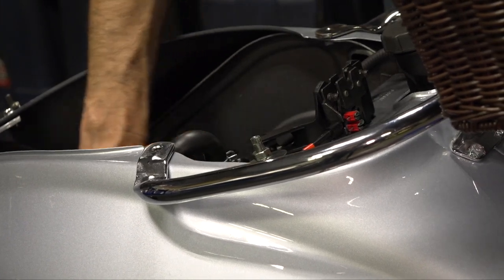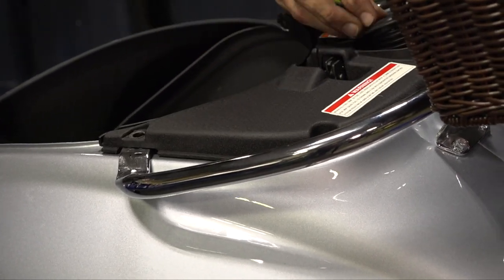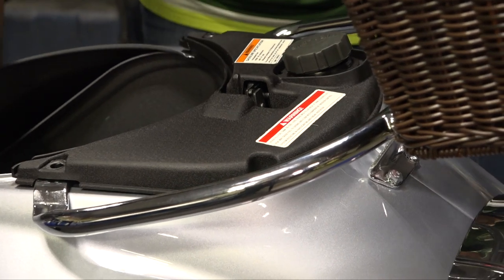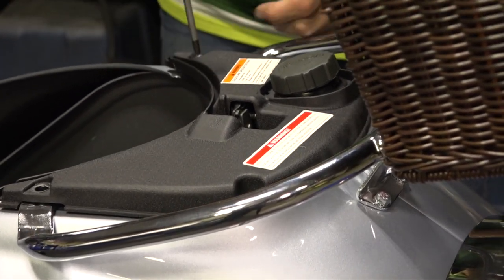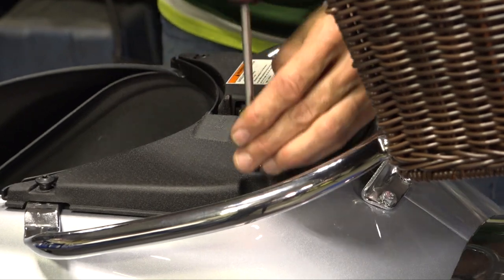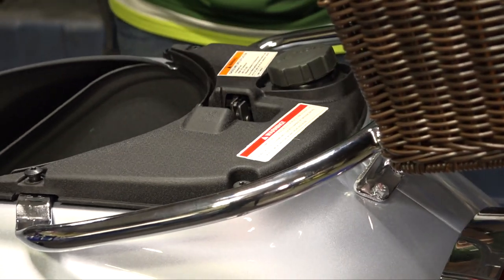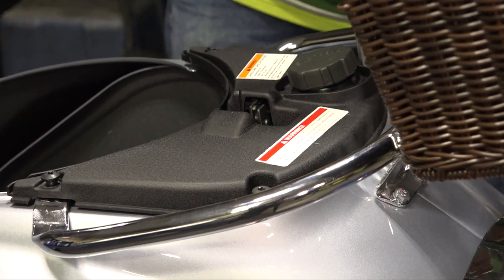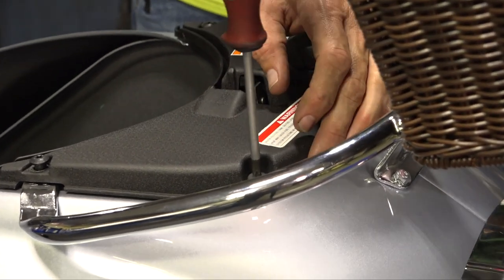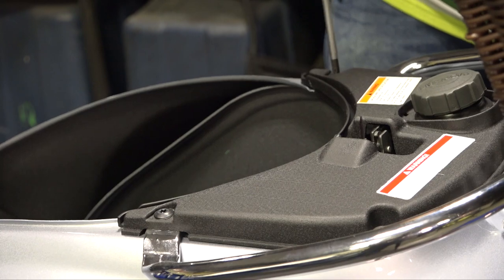Reinstall the cover plate. Put the rubber gasket for the fuel filler — it just drops right on — then put all the hardware back in place. Start all the hardware before going all the way down: the pair of screws with the steps go in first, get them all started, then tighten. Don't over-tighten these — they bottom out in plastic and will split it if you over-tighten. Then drop the under-seat bucket back in place and we'll get the lowering bracket installed.